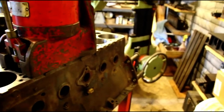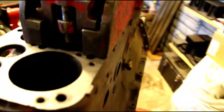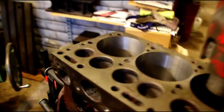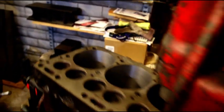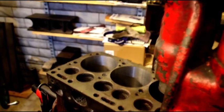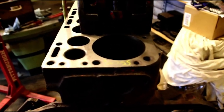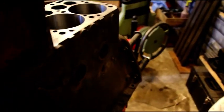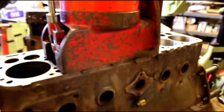It takes me seven passes with the boring bar to get from standard to three-inch 625. I went three-inch 625 even on one and 625-and-a-half on another. The forums say you have to have a shelf, so I put a shelf on. On small short-stroke engines it might be good to have a shelf or pin the sleeve, but on these motors with eight-inch long cylinders, a two-and-a-half to three-thousandths press fit means that sleeve isn't going anywhere. It takes an awful lot of time and money to sleeve a block.